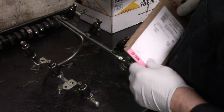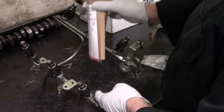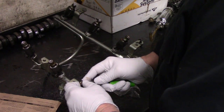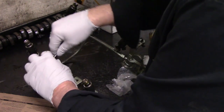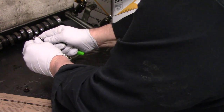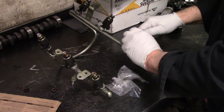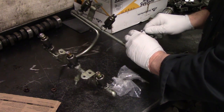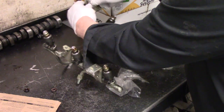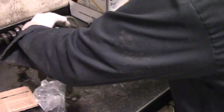Well, I wish I was replacing the injectors, but currently there are none available in town, and I would have to order them in, which is fine, but they're also rather expensive. So I am going to clean them up, replace the O-rings, and I'm gonna run some injector cleaner through it and cross my fingers. I don't like the fact that we didn't really identify the source of leakage. Service this regulator while we're here.